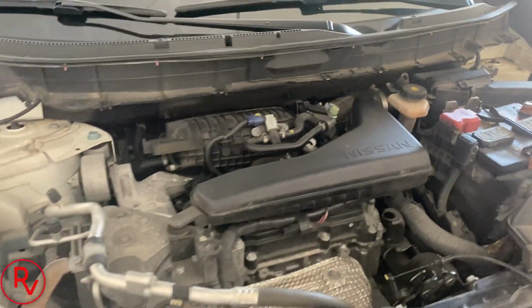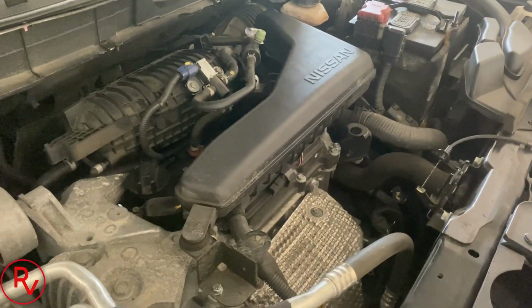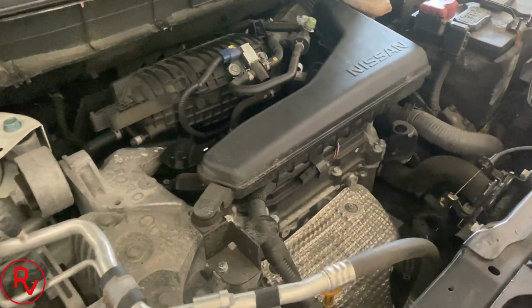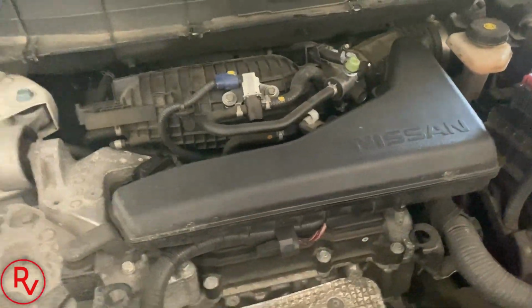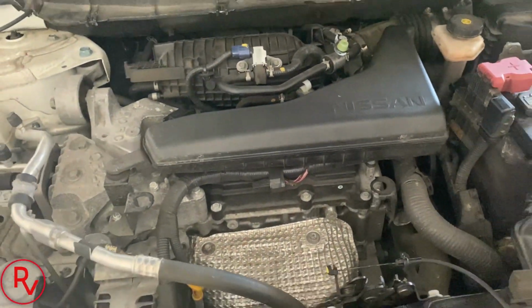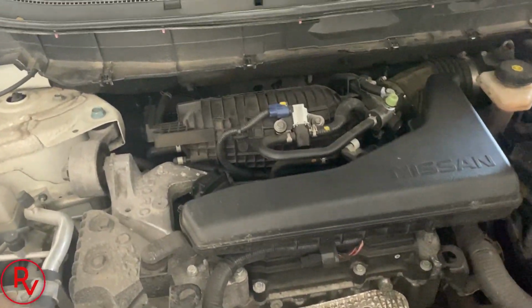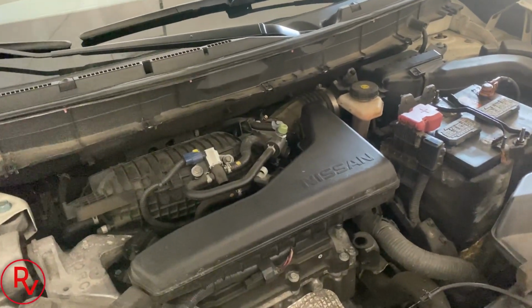All right, seems good. No noise from the engine. Seems like it's running good. I don't feel a misfiring. Always make sure all the coils are plugged in before you put this top piece in. I did that on the Cadillac, and I forgot to plug in cylinder number 6 when I did the spark plugs in that car, and it threw all codes and everything else.